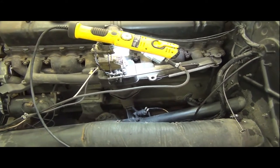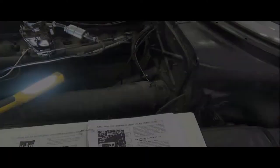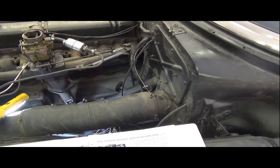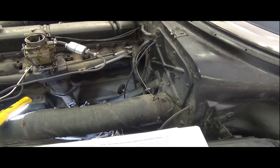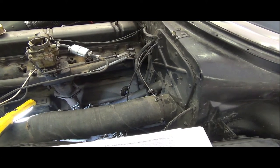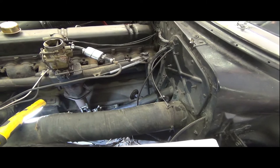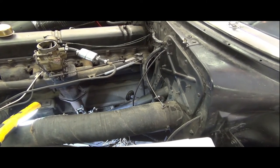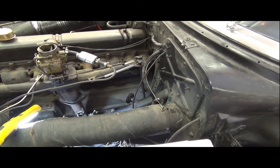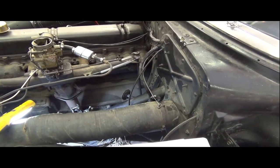Now I may actually wind up looking at this dashpot here and checking some of those settings to make sure that it is closing like it is supposed to. Well, now I'm not even going to do anything with the dashpot because unfortunately, the way you have to check it is you put your transmission in direct drive with the brakes applied, snap the throttle, release the accelerator pedal, and if the engine returns to idle too slowly, back out on the dashpot. I'm not really sure if I have the best hookup going on here with the transmission right now, so I'm not sure we're going to have a good dashpot adjustment. And I was driving it around fine before and it seemed to be just fine, including taking my foot off of the gas and just letting it roll, and it never did die. So let's just say that's close enough, at least for right now. If I really get bored later, and once I have other parts put together and this is running better, maybe we'll start obsessing over just how well the dashpot is adjusted.